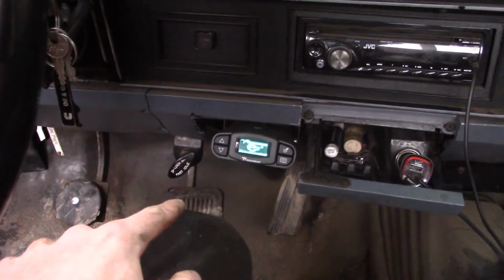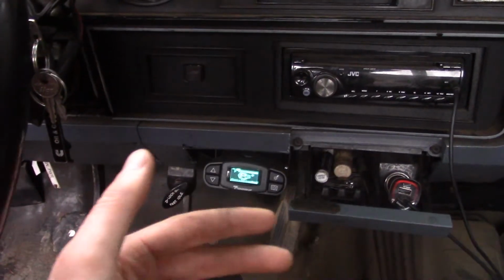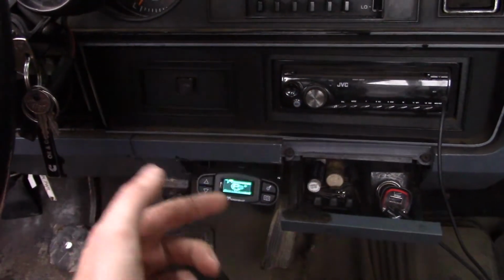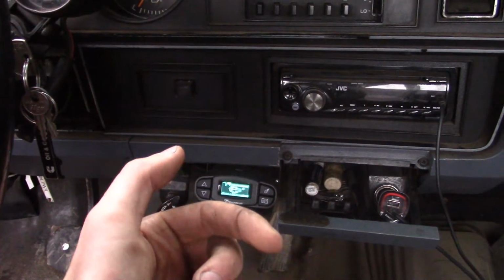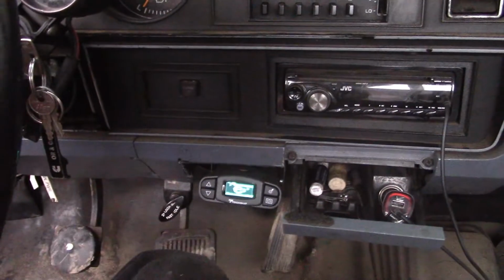Then as you press on the vehicle brake pedal harder, it'll apply the vehicle brakes, and the vehicle will slow itself and the trailer down. The controller will sense that deceleration, and depending on how much deceleration you have, it'll send a proportional amount of juice back to the trailer and apply more or less brakes or power to the trailer brakes, as the case may be.